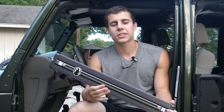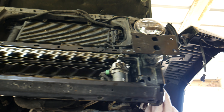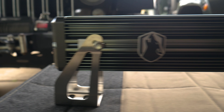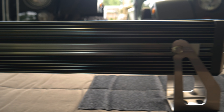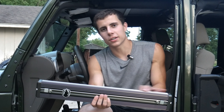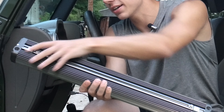This power steering cooler is made specifically for Jeeps. It mounts on the ends and goes underneath or right behind the bumper. It has mounting rails that go across the entire front and entire back, so you could mount this just about anywhere — on a lot of other vehicles besides the Jeep. This is a triple bypass cooler, so the fluid comes in one side, goes to the other, goes back to the first side, and then finally out. It comes in right here and exits right here.